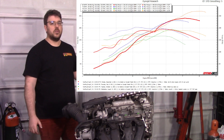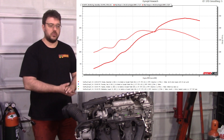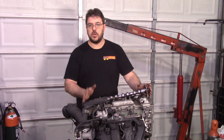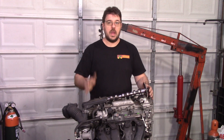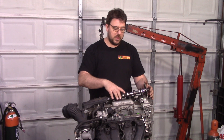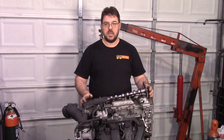That gets us to 241 wheel horsepower and 195 foot-pounds of torque. As nice as that configuration is — and I've actually raced it at 240 wheel horsepower and it's absolutely glorious — it's obvious in the build that the camshafts are built for a much higher RPM than the intake. The intake runners are just too long and not compatible, so your peaks are far apart and you end up making less power because of it.